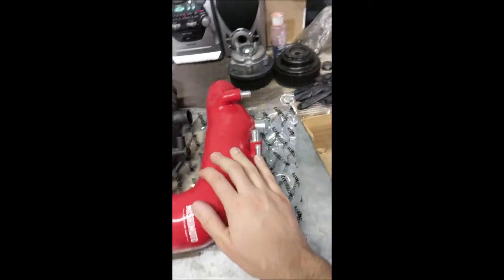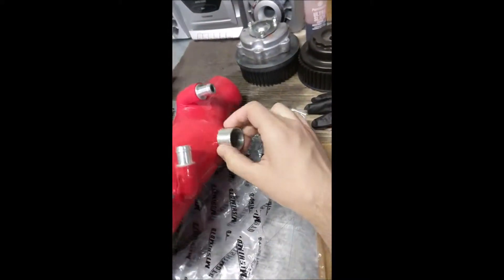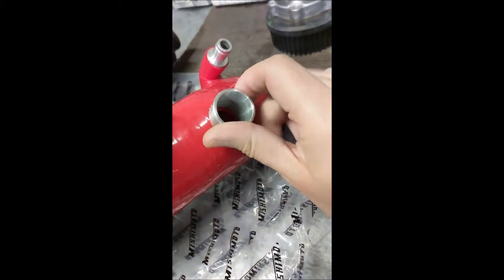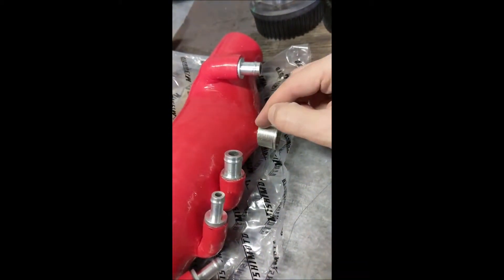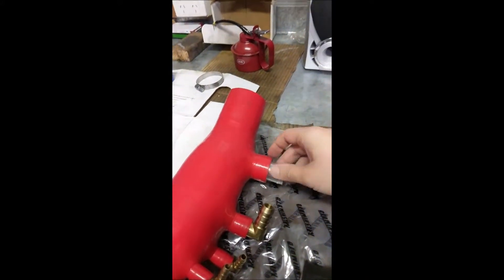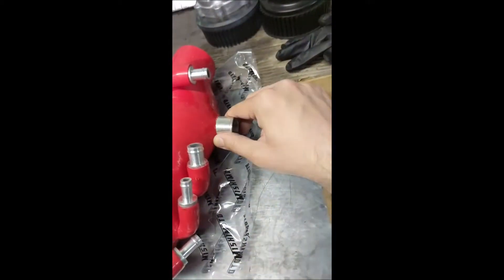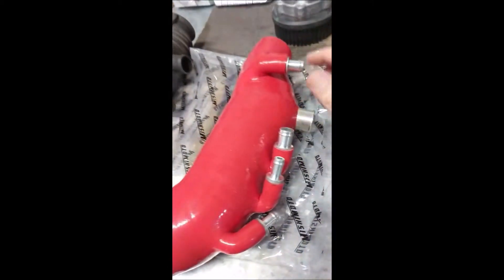The orientation of most of these fittings closely resembles the factory setup. The blow-off valve or bypass valve connection on the Mishimoto is actually molded as part of the turbo inlet — it's pretty much glued in there. You probably could remove it but it's not going to seal again. Whereas on the other design it's just a pipe — you can pull it out, block it off, do a number of things with it. I much prefer that design because you still get a good seal, it's removable, and it eliminates a potential failure point since the Mishimoto's may break down over time purely because it's glued in.